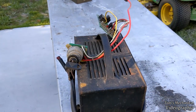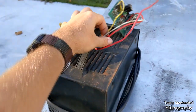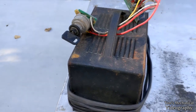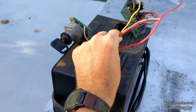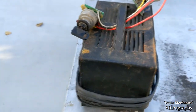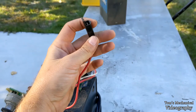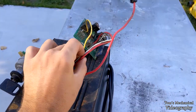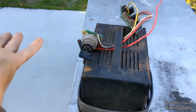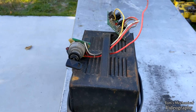That's got to be a money grab, some sort of relative engineering. Some relatives engineered this damn thing and they didn't have the heart to tell their boss their cousin was an idiot or something. But there really needs to be a butt connector right here so that you don't have to replace this entire thing if you blow the ignition. Because I mean, how hard would that have been? Just one more plug. You got a plug like this, just put four more of those right there, and then you could just disconnect the ignition cylinder if that got rained in and blew out.